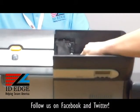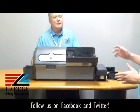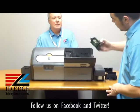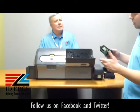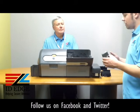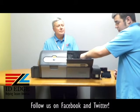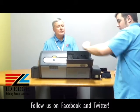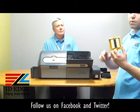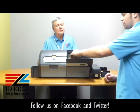It's actually fairly simple to replace. You have your cover, which keeps it protected from dust. There are little thumb screws that actually pull out the encoder for your contact and contactless encoding. And if you did not get this with your printer, it's very easy for us to field upgrade for you. All you really have to do is clip it back in. The mag encoder is in here, flipper table is in here. Also in here are the cleaning rollers for when you are printing, so it can get all the dirt off of those cards. It's kind of just like a tray and you slide it right back in.